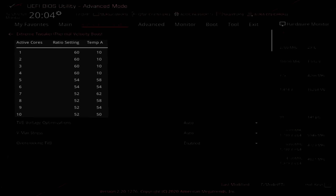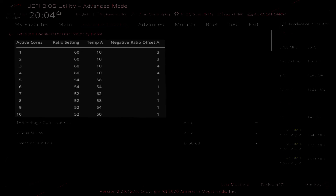Since we keep a fixed base clock frequency of 100 MHz, this results in 6 GHz and 5.2 GHz. The third column describes the first temperature offset point. When the CPU exceeds this temperature, it will decrease the ratio of the CPU. In my configuration, when the CPU temperature exceeds 10 degrees and 4 cores are active, then the CPU will decrease the ratio. Similarly, when the temperature exceeds 50 degrees and 10 cores are active, the CPU will also decrease the frequency. The fourth column describes the ratio offset for the temperature configured in the third column. When the CPU temperature exceeds 10 degrees and 4 cores are active, the ratio will decrease by 4. 60 minus 4 is 56, so the CPU will run the 4 cores at 5.6 GHz.